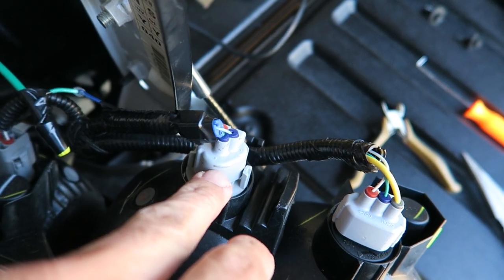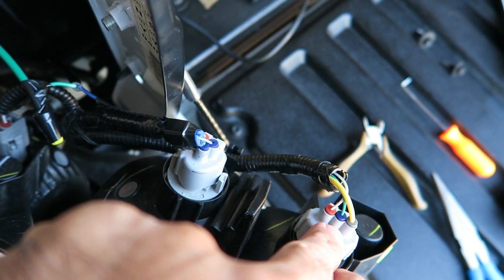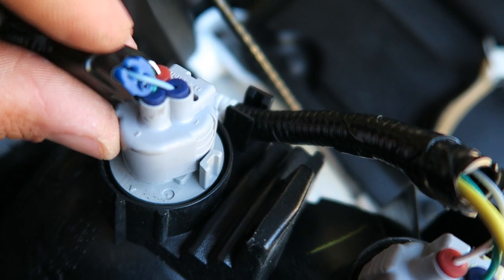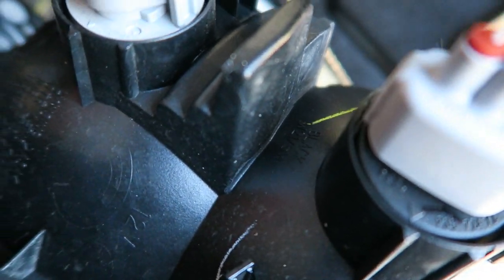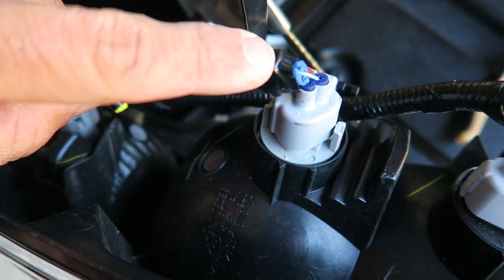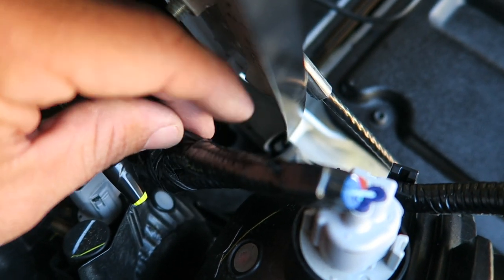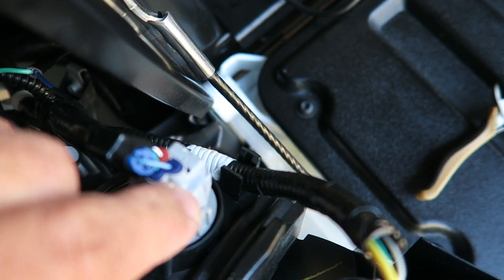You're going to come to the middle connector — this is for the brake light. Up here is the blinker, directional, and parking lights, and the bottom one is your reverse. When you get to this connector, pin number one is the brake positive, which is the blue wire. What I did was strip back the protection at the wire about half an inch — enough to get the splice in. I spliced it in using the blue wire as the positive on the wire I bought. You just splice into the light blue number one connector on the brake plug.